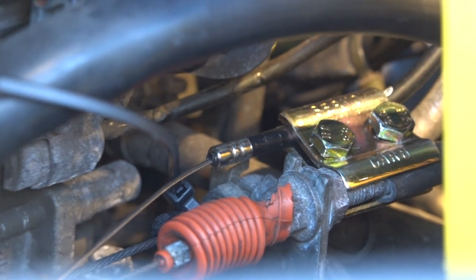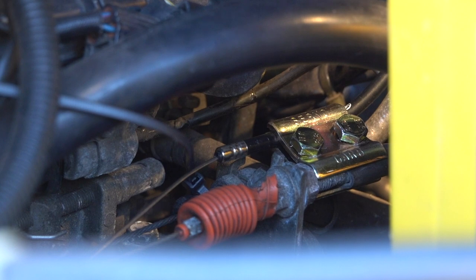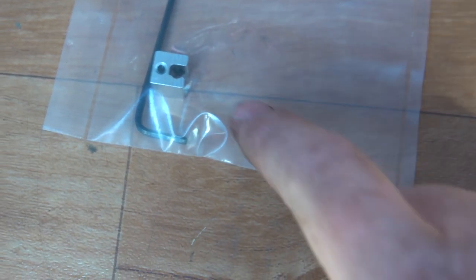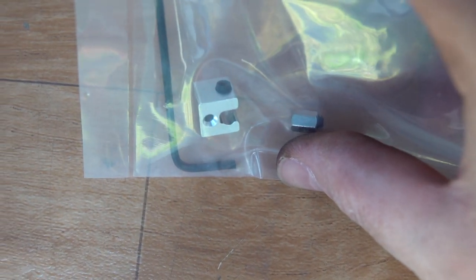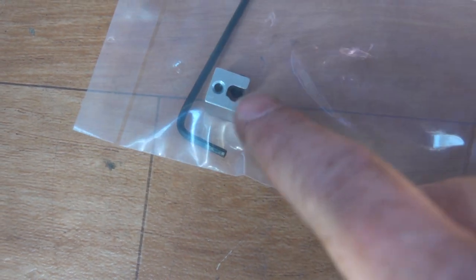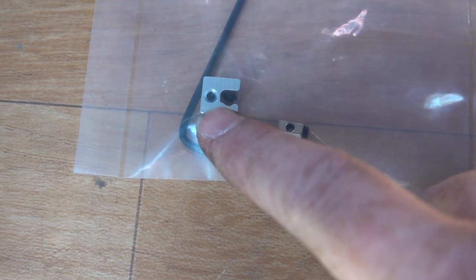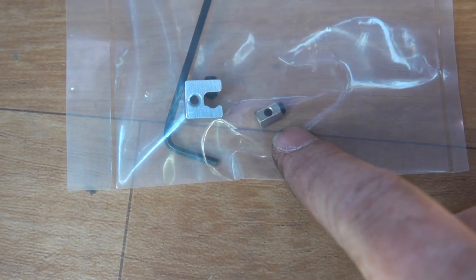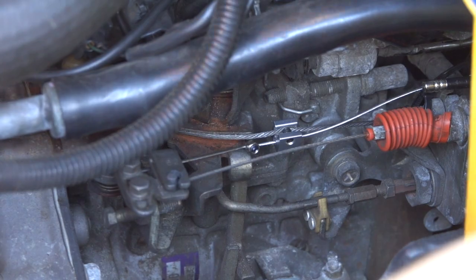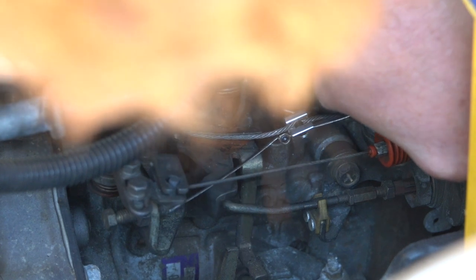We have to attach that silver braided wire to the throttle braided wire with the wire linkage attachment. The throttle cable goes through here and is clamped by the black grub screw, which tightens down onto the existing throttle cable. The control actuator cable goes through this hole and is secured on the other side with this clamp. Be careful you don't over-tighten because they will strip. The vacuum pump pulls on this, which then pulls on that, which then pulls the throttle.